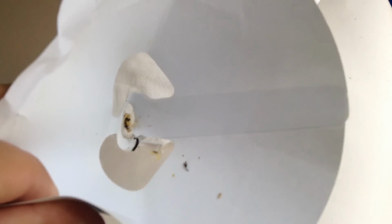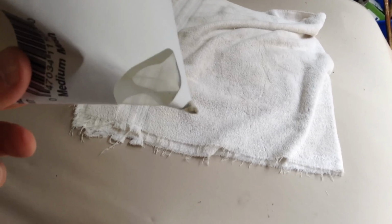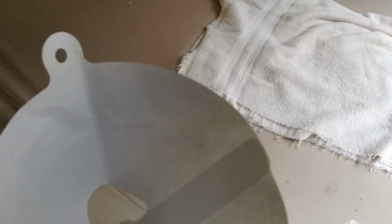I took the petcock off, 2 screws. This is what was in it. That black paint from the petcock wasn't actually in the tank, but these little shards, that's what was in the tank. And I drained the tank with this. I got this at Depot, like 98 cents in the paint department. I just drained it in the driveway. It was messy, but that's it. And I flushed it out with water. Spoiler alert: don't do that. Whatever.